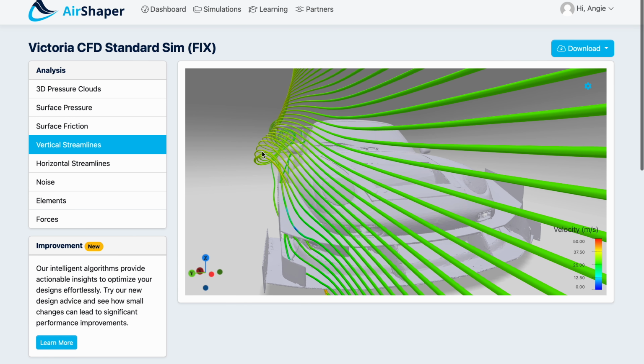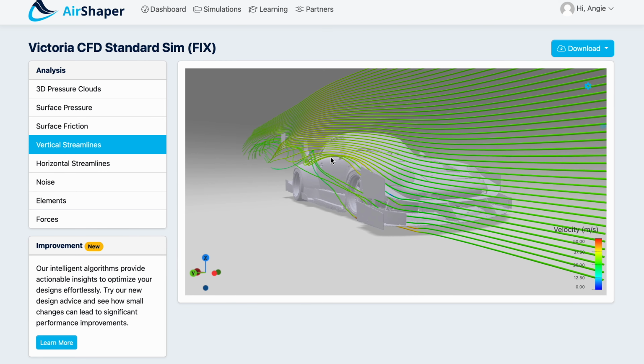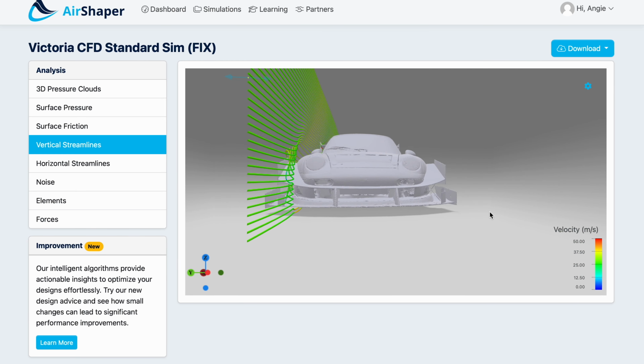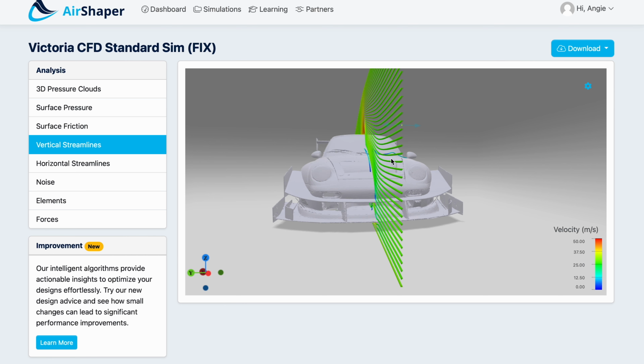As the air hits the round fender, that's why it is sort of detaching and then reattaching. So the problem with the wide bodies is they're not streamlined, but you do get more grip. So there's definitely something to compute for grip advantage versus drag coefficient.